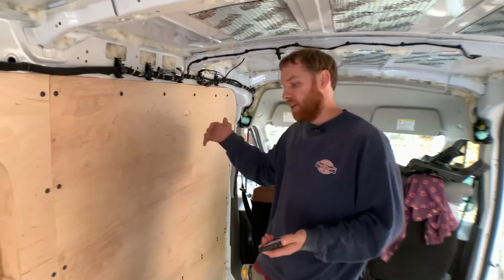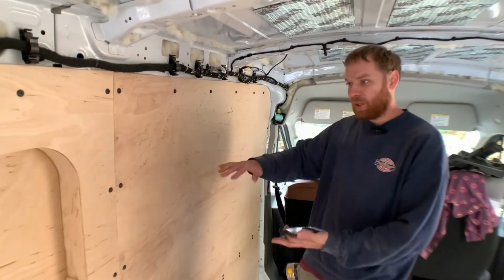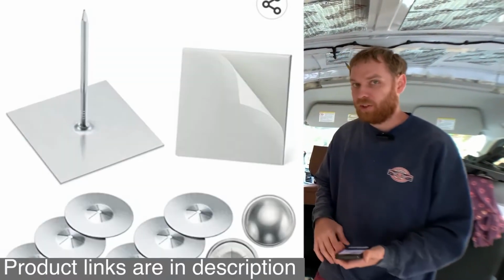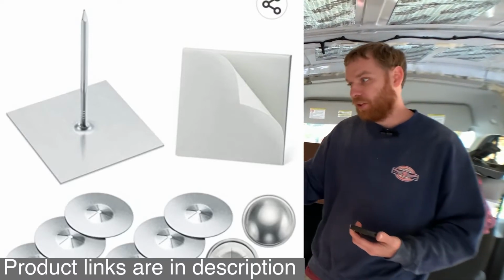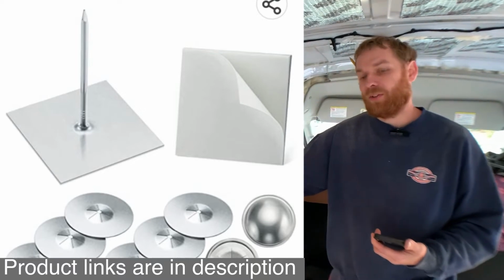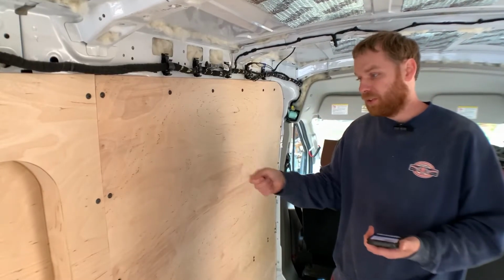So a product that might come in handy when installing the bats in large cavities that aren't broken up by framing members of the van is a product called a stick pin. It's like a nail with a washer on the back that you can glue to the metal panels. You can use even just silicone, stick it on there.